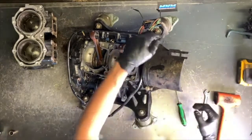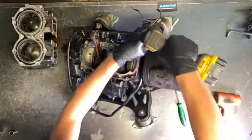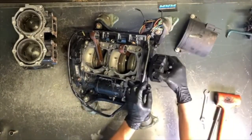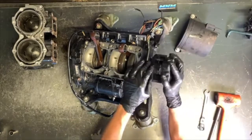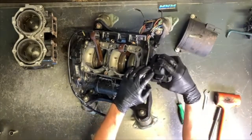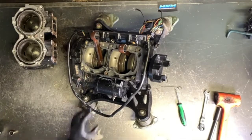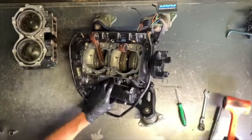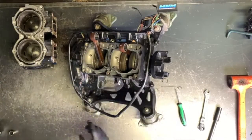I'm going to pull this coupler protector off — two 10 millimeter bolts. That's out. Now we've got our rubber cushion here — it's a very stiff rubber — and your drive shaft going to your propeller and impeller will attach right here. That's just a protector — set that aside. Our starter we'll pull off now. Just tap it off there — make sure you don't use a steel hammer, you don't want to break up that starter. It spins over freely; we'll check that before we go back together.